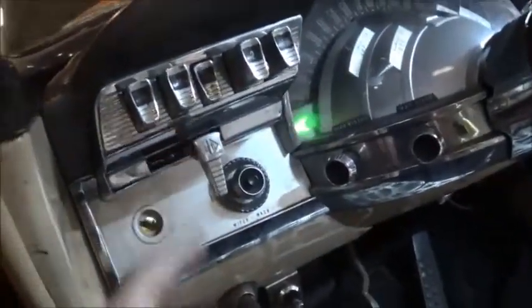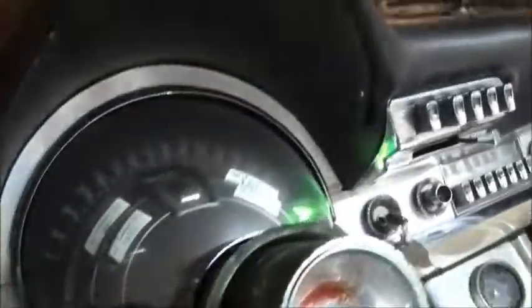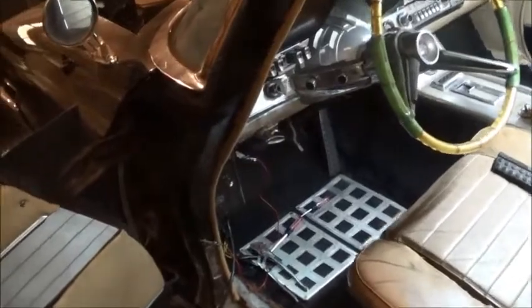And for the first time, we have rear turn signal on the driver's side. So that tells me, you are the problem. And there's passenger side working too. The test tells me it is the turn signal switch that's got to come out. And there's the cancel working as well — how nice.